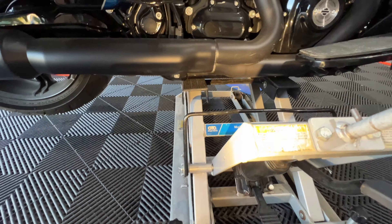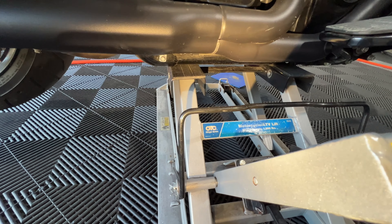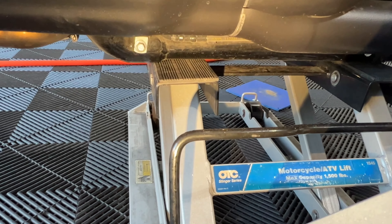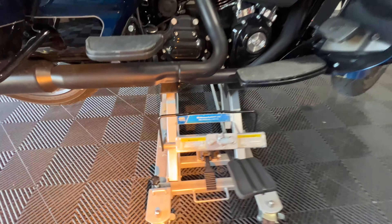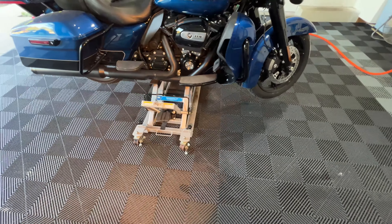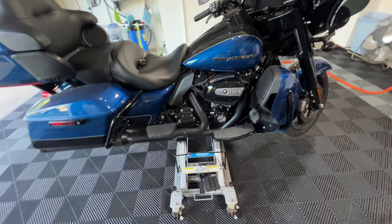You can see I'll shine the light here. I always try to aim that left support right about where the weld is there on the frame. That seems to get it nice and balanced. So we always like using a jack to get that thing off the ground so we can get to the wheels a little bit easier, much easier.